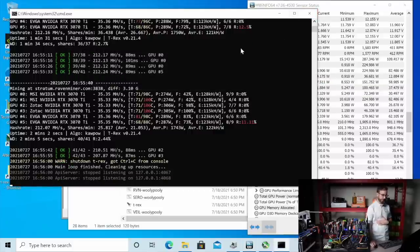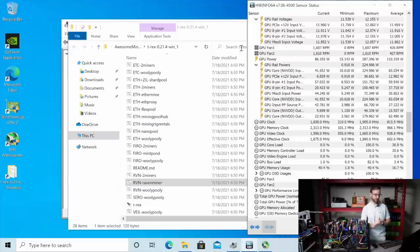I'm going to close this down because we got to reduce the power on this thing. That is getting a little out of control. I could just feel the heat radiating off of this rig right now. It is wild. This is the most power I've ever pulled out of a mining rig ever. Even my 12 by 3070 rig since it's power limited on Ethereum is only doing 1500 watts, and this thing was just pulling 2000 watts.